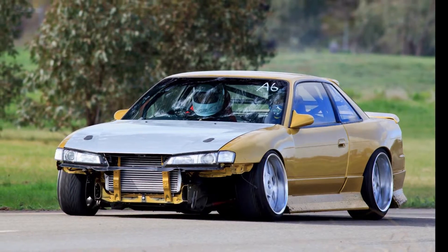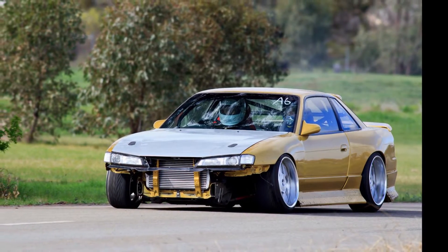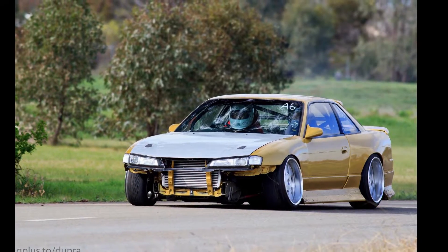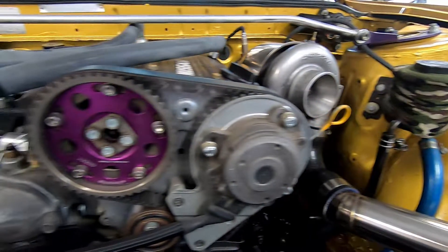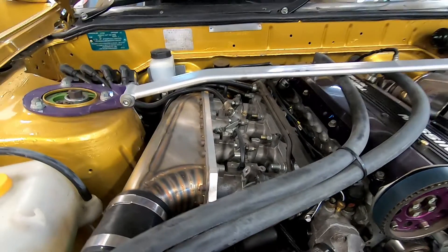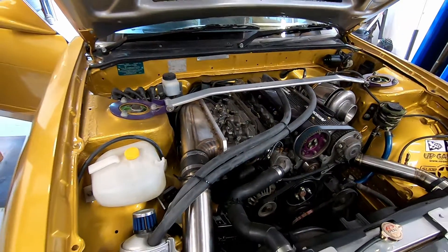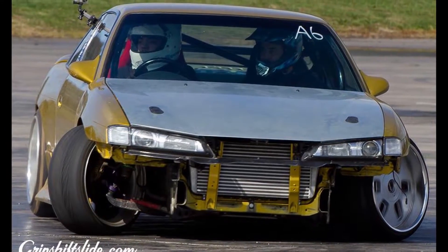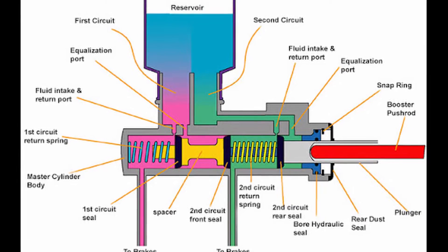Fast forward to today — now I'm sick of it. I want brakes that actually stop without me needing to jump on the roids before I drive. In my case I didn't have room for the stock master even after the booster was gone, so I was forced to save as much space as possible. A 7/8th master with four piston calipers on the front and two piston calipers on the rear without a pedal ratio correction is extremely hard underfoot. Yes it stops — I even ran two events with this setup — but the pedal is harder than your creepy uncle on Viagra.